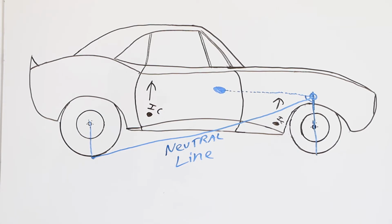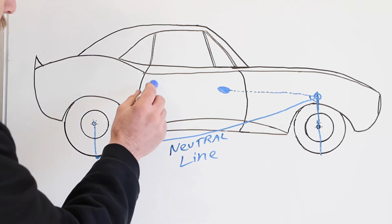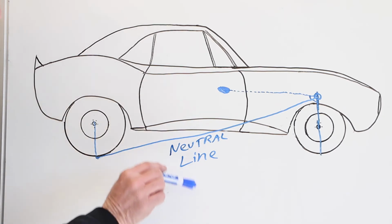Remember from earlier readings that there is a relationship to the height of the instant center. As it gets moved higher in the car, the tire gets hit harder. As the instant center location is lowered, the tire gets hit less hard. Therefore, when you start to combine the thinking about front to rear instant center locations with the height information, we start to intuitively relate to a form of pitch rotation engineers call anti-squat. End of quote.